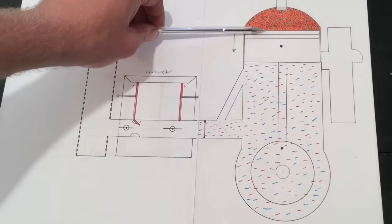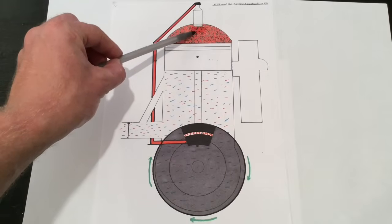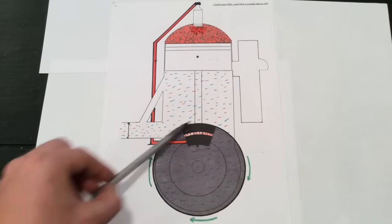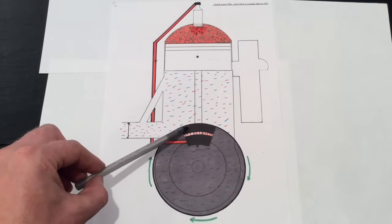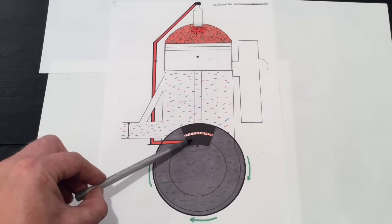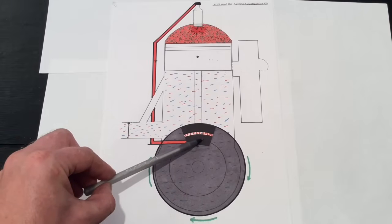The piston went to the top, compressed the fuel and air mixture, and the spark plug fired. I'll briefly go through what creates the spark. Bolted to the side of the engine, as we know, is the flywheel. And this flywheel turns with the engine — it turns that way. As part of the flywheel structure, we've got a magnet there that moves with the flywheel. The bottom one there is a coil pack, and that's bolted to the engine itself. So the magnet's bolted to the flywheel, and the coil's bolted to the engine itself — and inside there are the coils.